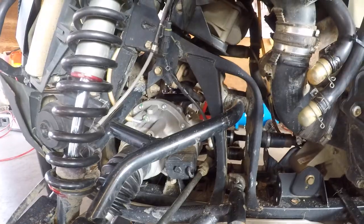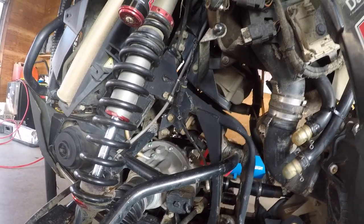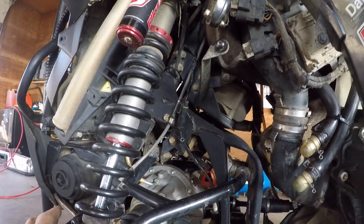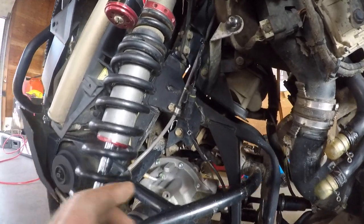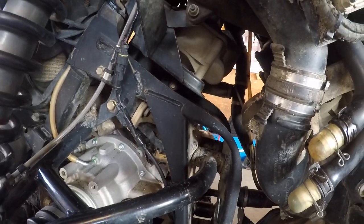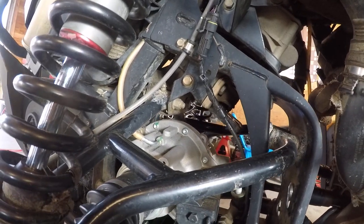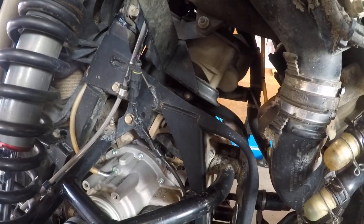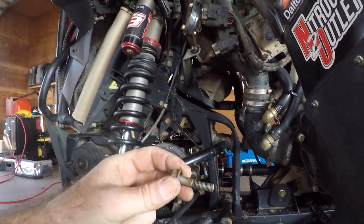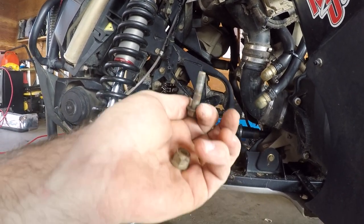Far enough out of the way. All right, so I got the tie rods out of the way, so we can unbolt that Pitman arm now, and then I think we're going to be loosening up the power steering unit there, and then we'll go at that extra action, see how that's going to go. I hear tell that these aren't too bad on this side, but on the other side apparently they'll break off the welded nuts that are on the inside. So I think there should be enough room to drop that Pitman off there now once I remove that plate. We'll get at those pinch bolts, see how she goes. There's that pinch bolt right there from the top of the Pitman. That don't look good. Think there's a little bit of stress on her, boys? Just a touch.